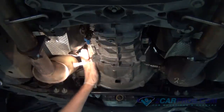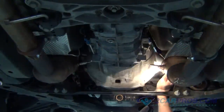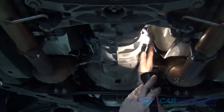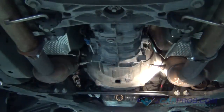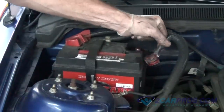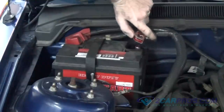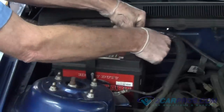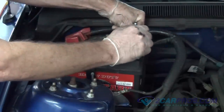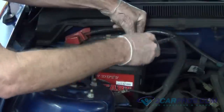After reconnecting and mounting the exhaust system, go over your repair, making sure everything is reconnected properly with nothing touching the exhaust system. Next, reconnect the negative wire to the battery. It is a good idea to lightly tap the terminal with the wire to see if there are any major sparks or loud noises happening when reconnecting the battery, indicating something is wrong. Using the appropriate size wrench, tighten the clasp for the negative battery cable.